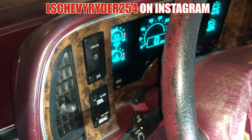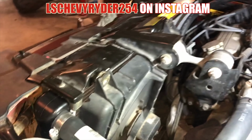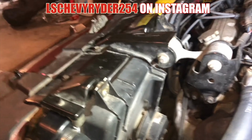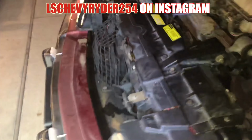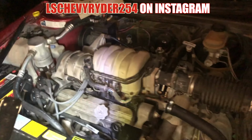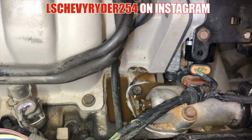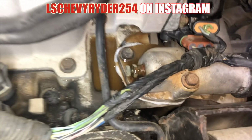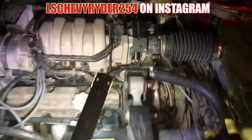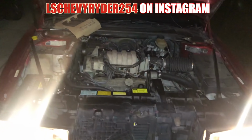I mean, it's right there at the half, you know, it's not like overheating, but if these fans weren't on, then it would definitely be there. But as you can see, it's still bubbling, it ain't being constant, so we do know there's still some air in the system, so that's gonna do it for this one, man.